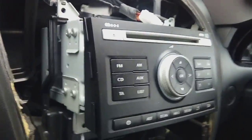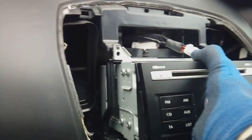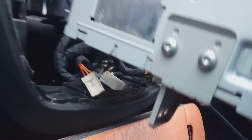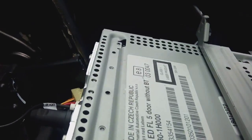We've now removed all four screws. Just grab hold of your stereo — it's quite a weighty thing, so you want to get some foam or cardboard to pad out below it because you don't want to drop it down on your plastic and scratch everything. If the gear lever is going to be a problem, put a bag over the top of it to stop that getting scratched. Grab the radio, give it a bit of a wobble because it's on some plastic lugs, then drop it down. Watch the metal near your dashboard — you don't want to scratch anything.